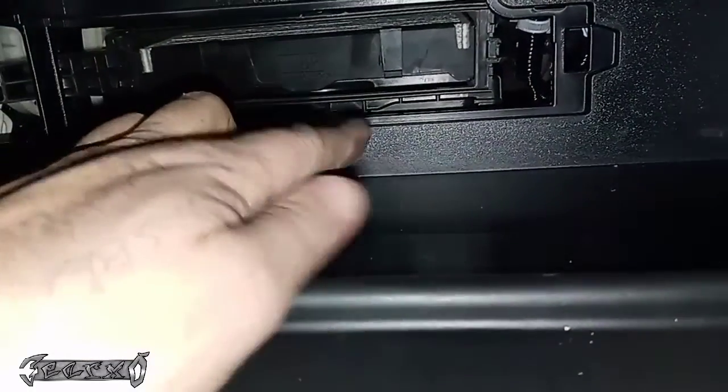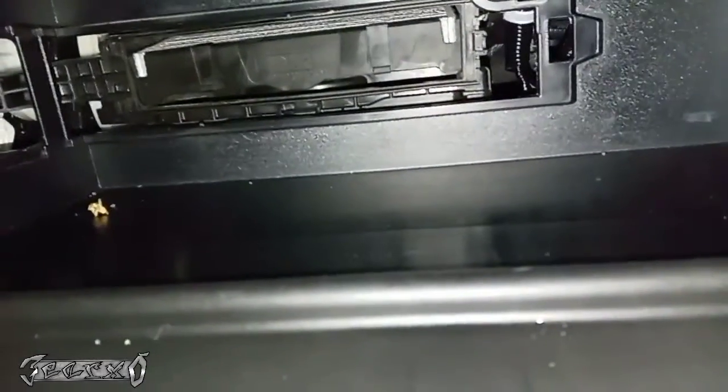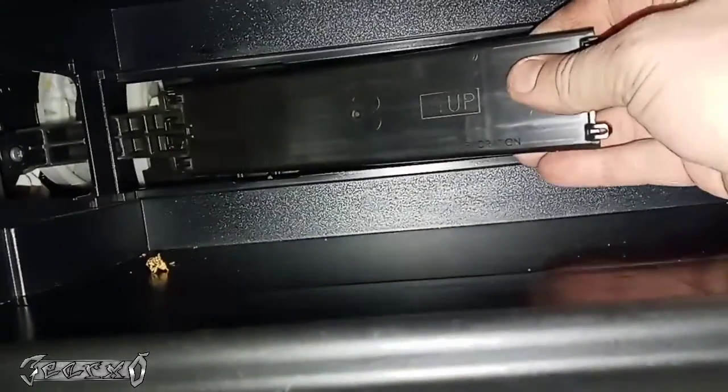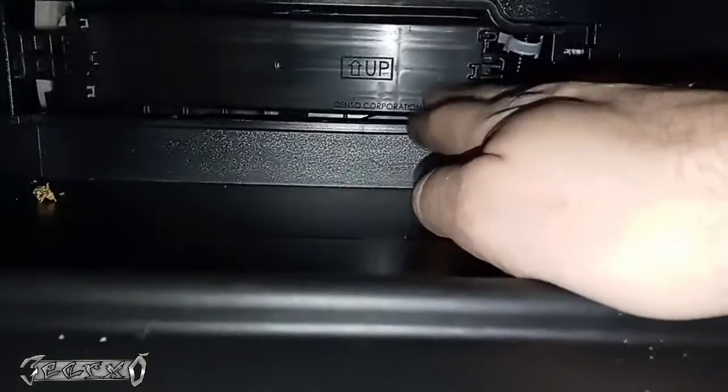— with your key out and the blower motor off, you could reach in there with your fingers and kind of get any leaves or debris out. Rat nests get in there — one time I had one that was full of acorns. Okay, let's put this on. This side goes on first, slide the tabs in, then push this side right in like that.